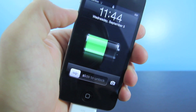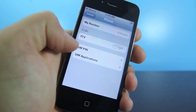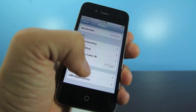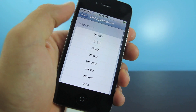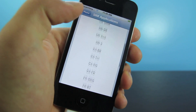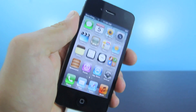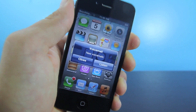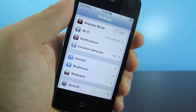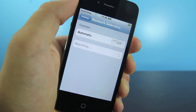Now go ahead and power it on. Upon reboot, slide to unlock, go to Settings, Phone, and scroll down — you should see two tabs. If you just see SIM Pin, wait and SIM Applications will appear. If you don't see anything, reboot and wait, and eventually they will appear. Once you do see them, go into SIM Applications and scroll to find your carrier, whichever it may be. For me it is US Sprint, so I'm going to select US SPR. If you have AT&T, that's up here; if you have Verizon, that's down here. Select your carrier and go ahead and power down your iPhone. We're basically going to be disabling the automatic carrier selection, because for most of you it will take you back to the activation screen — so make sure to turn it off when it does appear.